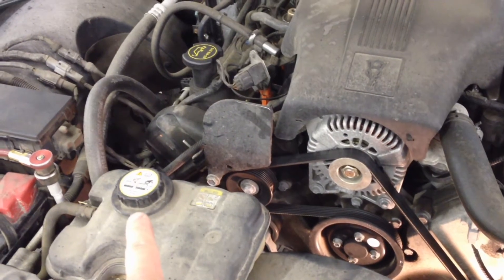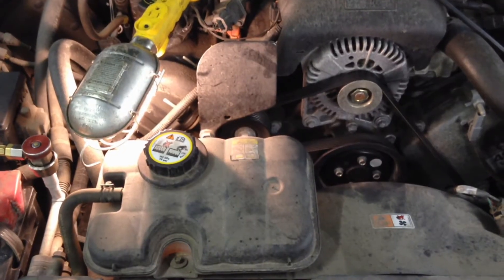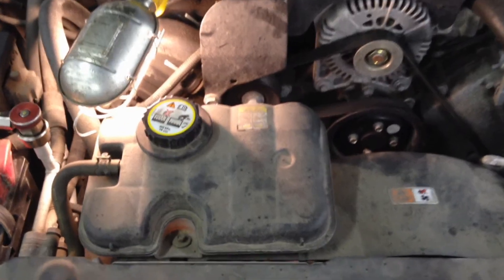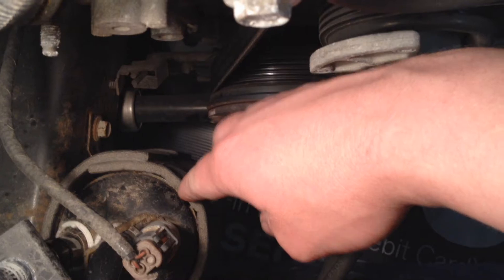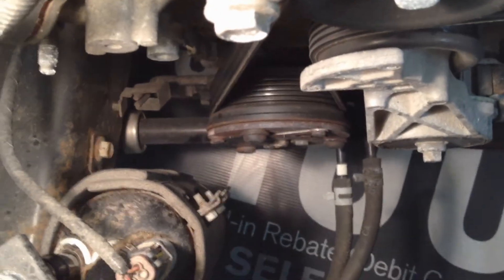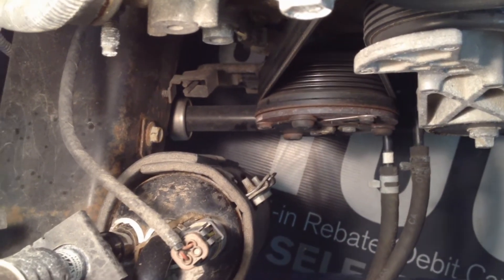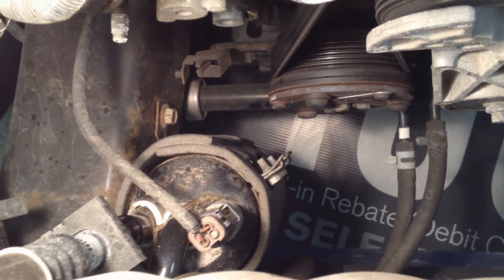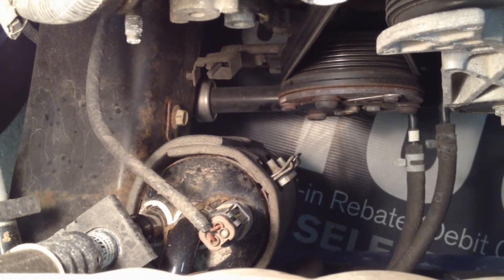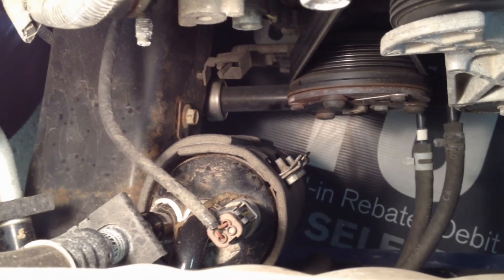We're going to concentrate on the AC accumulator — take it out today, change it out, and I'll show you just how it fails and why they thought it was a coolant leak. The AC accumulator is right behind the coolant reservoir by the fan. There's foam wrapped around it for insulation, but the accumulator sweats on the outside, trapping dirt. The tank is steel, so between the moisture and trapped dirt, it actually rots out — you'll never see it up top, but you always see it down below.